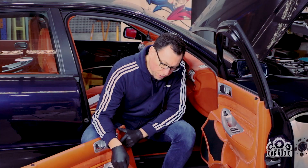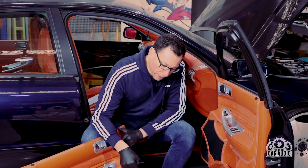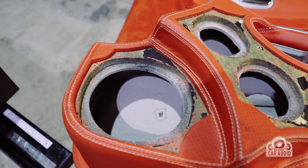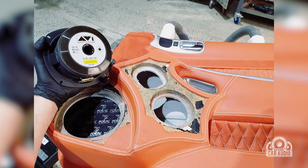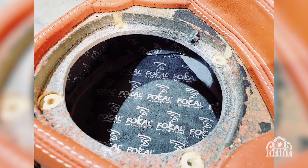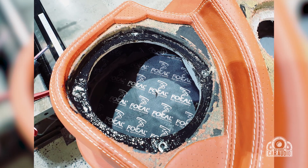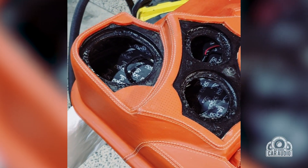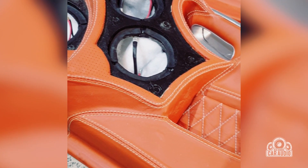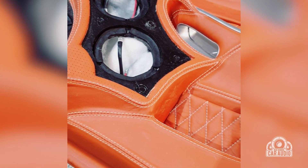The first step was to clean out all the old glue and MDF used on the inside of the door where the speakers will mount. We've re-fibreglassed the back of those and used heavy epoxy to strengthen the MDF which is very powdery. We've gone through and sound deadened the inside of the door trims and fibreglassed the back of the trim, taking great care not to damage any of the leather trimming — which has been quite a challenge.